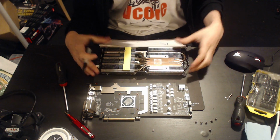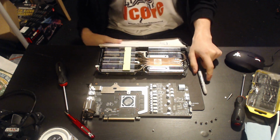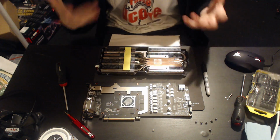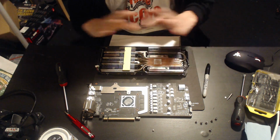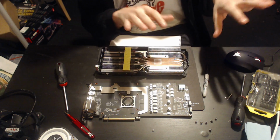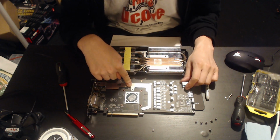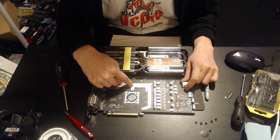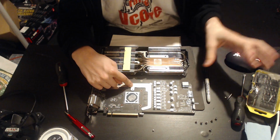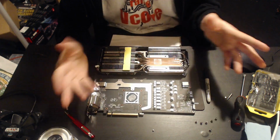And while I don't like relying on software ratings, for the International Rectifier 3567B, I tend to trust it. It's not so horrifically wrong that you couldn't say, if you have two GPUs with the same voltage controllers, then it's going to be similar, kind of close in terms of readings. So this card seems to pull about 20 watts more than my GTR, and my GTR is a stellar example of an RX 480. That thing is top 5% at the very least. This would be, I think, slightly below average for overclocking capabilities and thermal properties.